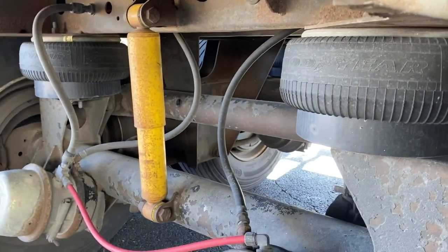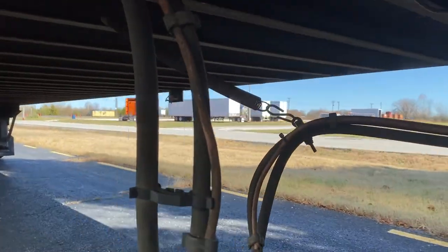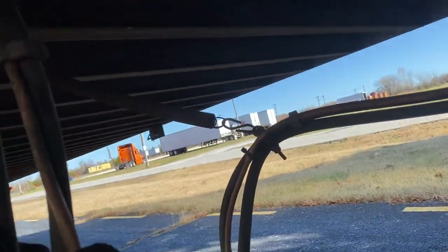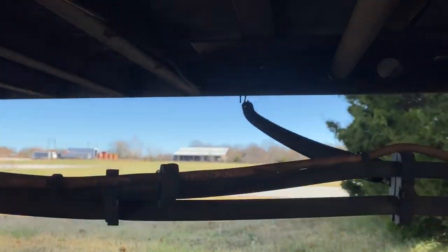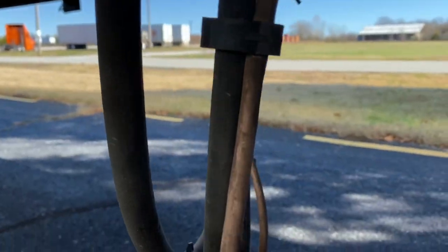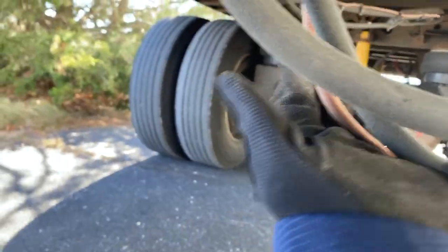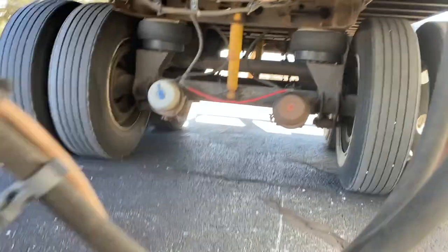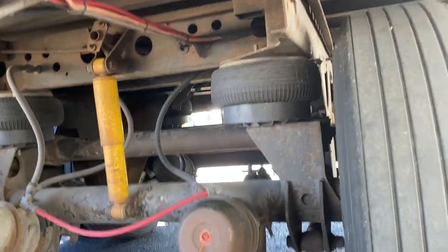From here I want to go to the hoses — the air hoses are not cut or frayed, no visible leaks on any of the hoses. They're mounted securely with two springs here, mounted securely and clamped securely. You want to make sure that the hoses are mounted above the rear axles — that's an important thing to mention.